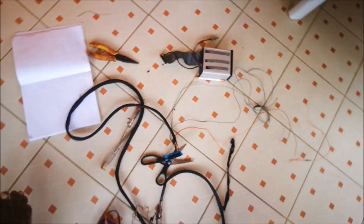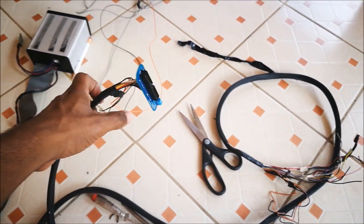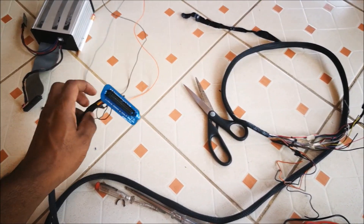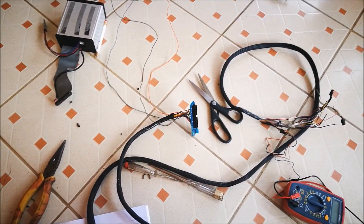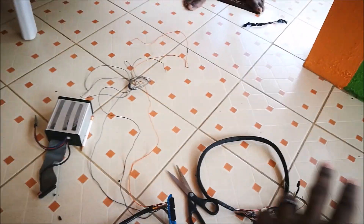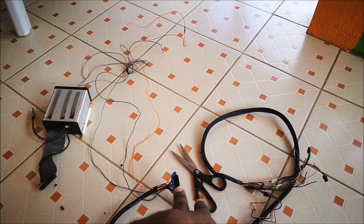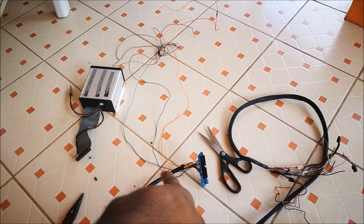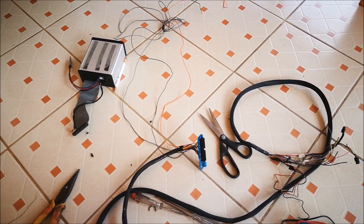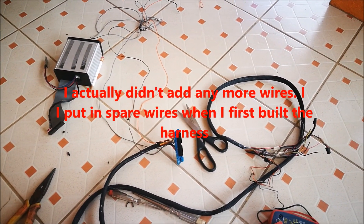The harness is already done. Vibert bought the ECU setup from the previous Altezza — the white one with the 3S — because Yogi ended up selling the car and took off the ECU. So we're basically adding a few more injector outputs, since it was only done for four cylinders, and we're adding a control wire for the supercharger clutch.